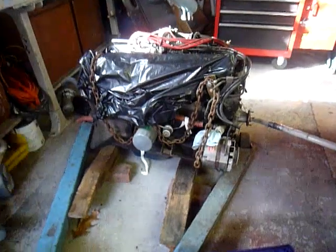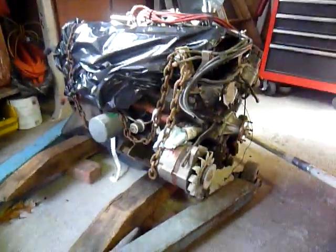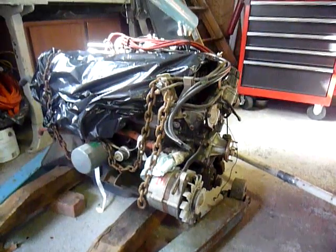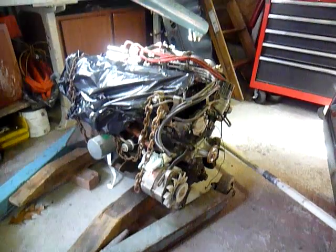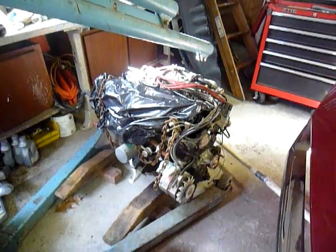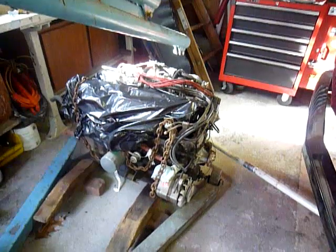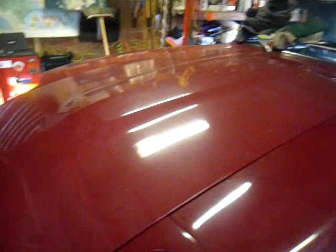And here's the motor. Here's the L28 that's going to go in there, L28E. That's out of my 280Z. That was replaced with a turbo motor. That's going to get the makeover. External gaskets, paint, and cleaning. Triple Webers, headers and open exhaust. And remain basically internally stock and unopened. 130,000 miles, so it's a baby. It's going to drop right in here.